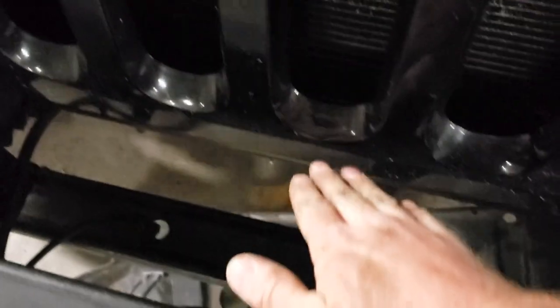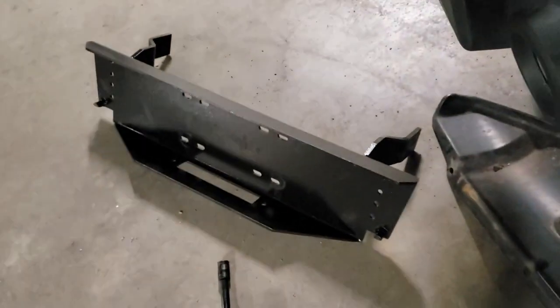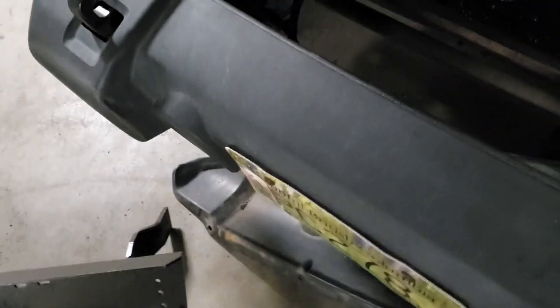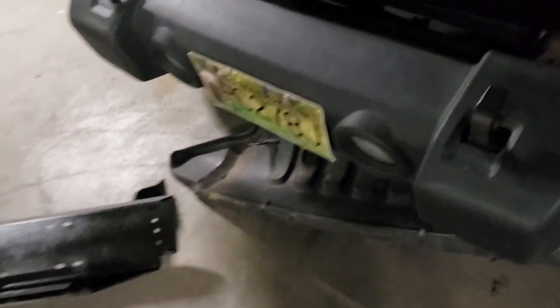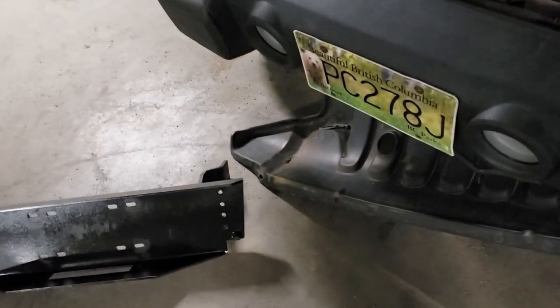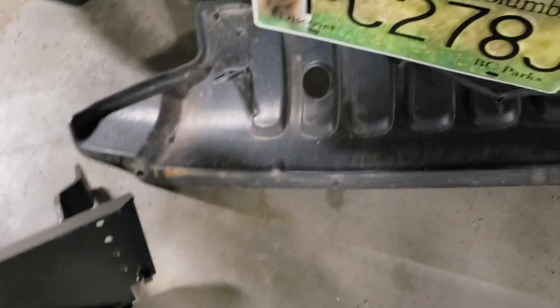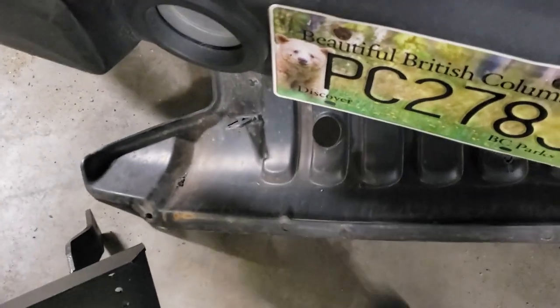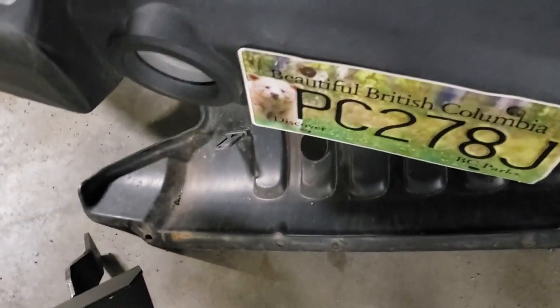About 15 minutes in: I removed the plastic cover over the frame rails and unhooked the fog lights — don't forget to do that. They say you don't have to remove the bumper completely, but I tried sliding the plate in without removing it and decided to take it right off so I can make sure everything lines up correctly. There are only two bolt holes, so I don't want to mess around. Also, the air dam on the bottom — you don't have to remove it all the way, just take off the front bolts and let it hang so you can get your arm up in there.